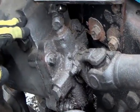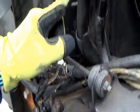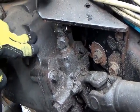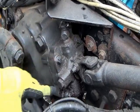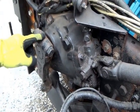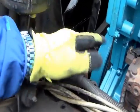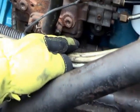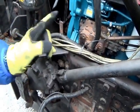Down to the gearbox. This is the gearbox. Fluid from the power steering reservoir goes down this hose to the gearbox. So that means the gearbox is holding fluid. So you say not cracked, not broken, and secure, no leaks, no loose or missing parts. Then you want to mention there's another hose that goes to the back from the power steering reservoir, and it goes down the back, and that would be your steering pump. The pump is not cracked, not broken, and secure. No leaks, and it's gear driven.